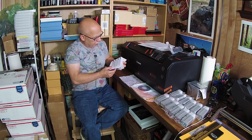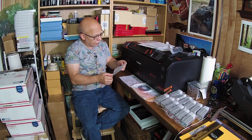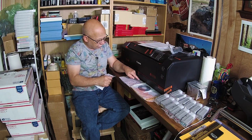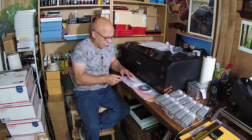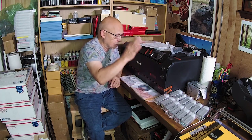I have some very interesting warnings here. I have not gotten into the full setup sheet yet. It talks about a lot of warnings — not to do this, not to do that. It says here we're installing the printer tanks in this printer for the first time. The printer becomes operational by filling the section from the ink tanks to the tip of the print head with ink. Therefore the number of sheets that can be printed on the first ink tank is fewer than the succeeding ink tanks. What they're saying is that most of your original ink in these cartridges will be used up to fill the system.